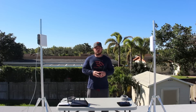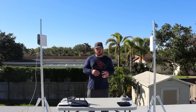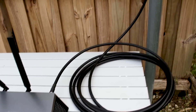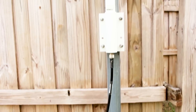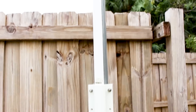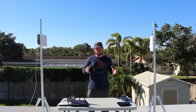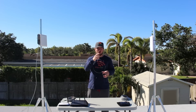Let's say you can't move your router. The next thing you can do is add stronger antennas to your existing router. You can either run a coax cable out to the roof or outside and then attach a directional panel, a directional Yagi, or go with an omnidirectional 11 dBi antenna. That'll get your signal physically through the cable outside, eliminating all obstructions from within the house so that the repeater can see a much better, clearer signal.